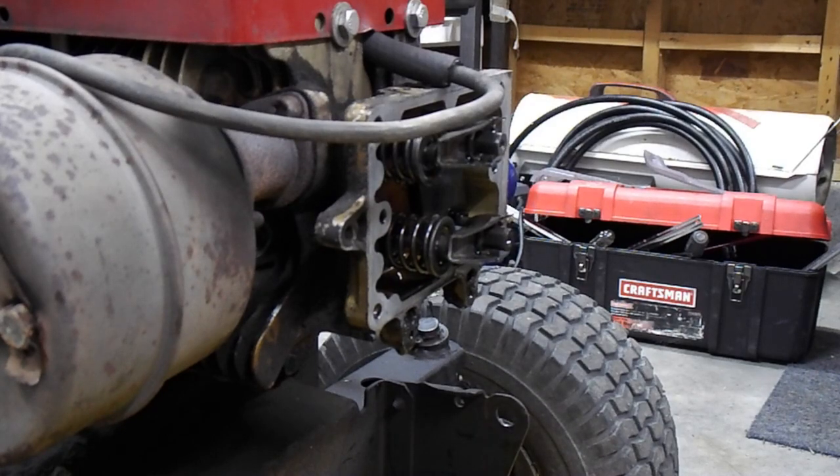Okay, we're back everybody. I ran the lawnmower a little bit today just to drive around and see how it runs. It does have a hard start problem, which was kind of evident in the last few scenes where it would hit a rough spot - kind of like trying to get over a hill. That's usually a sign of the valves acting out, especially with the backfiring. So what we're going to do today is just the valves - we're going to adjust the intake. That's usually the sign that the hard start issue is the intake valve being out of adjustment.